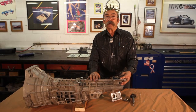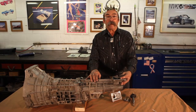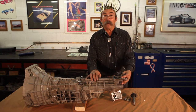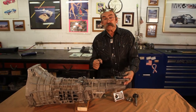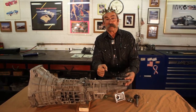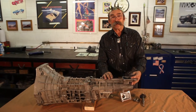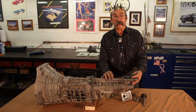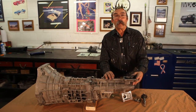Next we're going to talk about a poor man's short shifter. A poor man's short shifter is something we do here in the shop when you have an aftermarket radio that sticks out too far away from the dash, so when you shift gears you actually change your radio stations with your knuckles — it's called a knuckle buster. So we're going to show you how to shorten your stock gear shifter on the Mazda Miata and create a short shifter for the poor man.